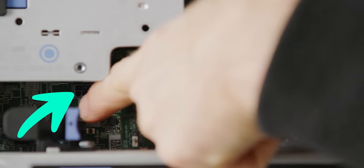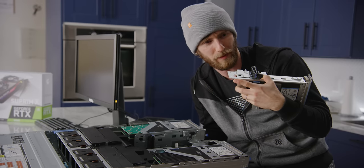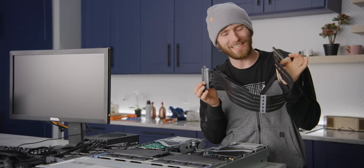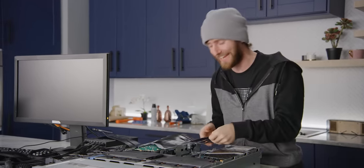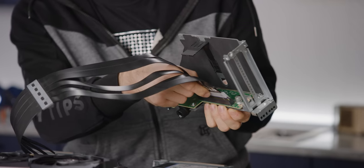Dell has a proprietary 12-pin connector so that I can go to dual 8-pin and then back to a 12-pin. Fortunately we have a plan — since we don't actually need to install this in a rack unit anyway, we can just take a PCIe extension and run the graphics card wherever we please.